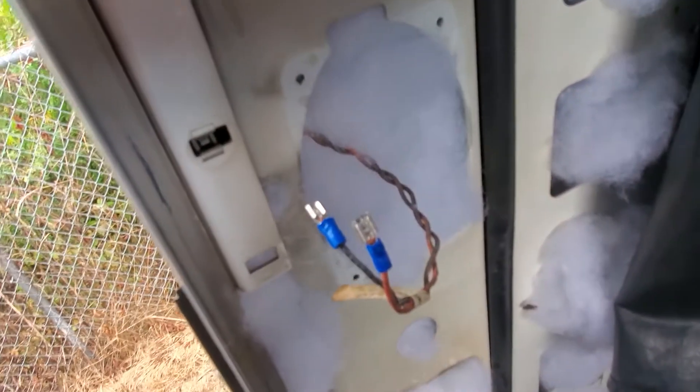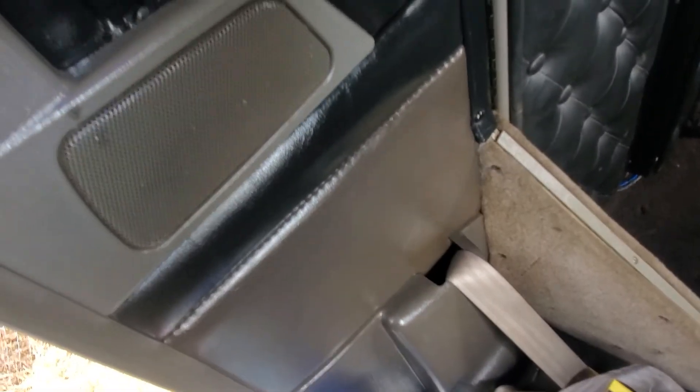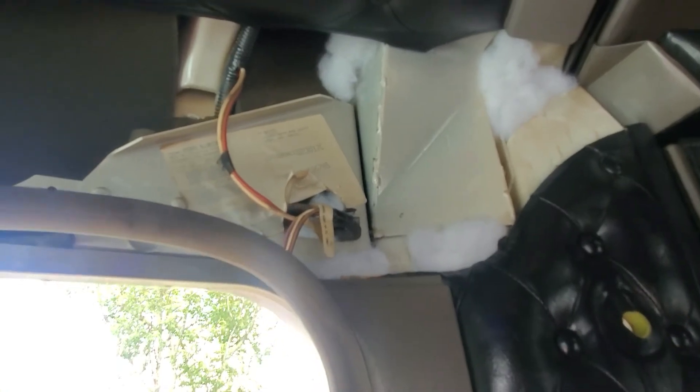Got this side done — another speaker installed. Now I'll show the driver's side. Got that curtain out of the way, and this one was bad — the driver's side door had a bunch of screws inside, that was a pain. I took the top one out, took that little block out, pulled the curtain a little bit to the next block, stuck it back in, and it went pretty easy. Getting the panel back together, lining it up, and we're going to go across the top and finish this — probably on another video. Thanks for watching.